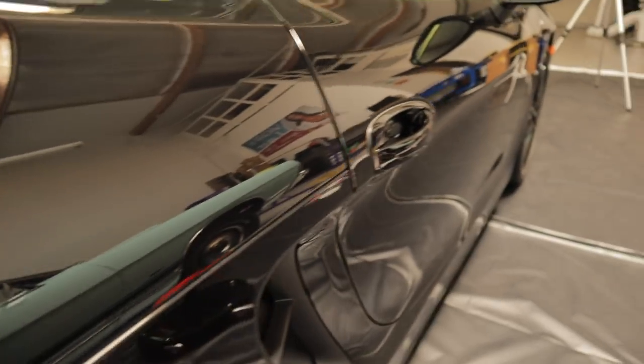So nice and glassy. And now I'm going to be going ahead and doing my isopropyl alcohol wipe, getting it prepped for the ceramic, and then we'll go ahead and throw ceramic on. We'll do the first coat, and then we're gonna be doing G-Technique Crystal Serum Light. We're gonna be doing one coat, letting that cure overnight. Tomorrow I'll come back, and I'll do two coats of EXO on top of that.